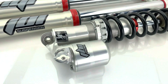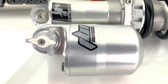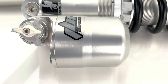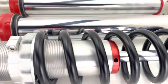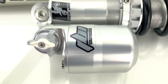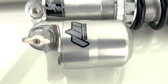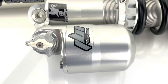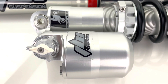By no means is the stock piston bad — it works quite good. It is quite large in area, so the piston itself does not have to move up and down that much to account for the change in volume from the shock shaft. That's why they enlarged the free piston diameter on this. This is the most effective and probably best free piston design that WP has had on any of their production shocks to date.